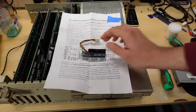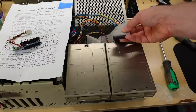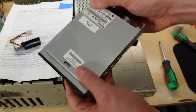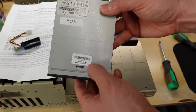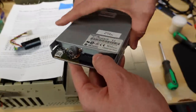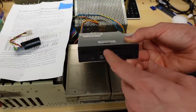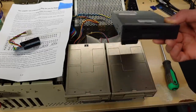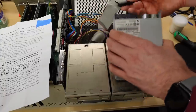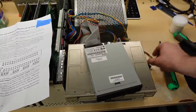We're actually here to talk about this floppy drive adapter that Robert sent me. This cable that plugs into the disk drive looks like it should work on a PC floppy drive — it's electrically very similar, but there are some signals that are slightly different. This is a 1.44 meg drive I found at the thrift store, made by Panasonic. This drive doesn't have any jumpers on it, so it's fixed for drive select one — you can't change it to drive select zero, which the Amiga uses. The key differences are the ready signal and the disk change signal.